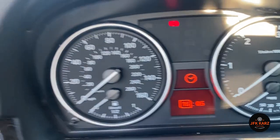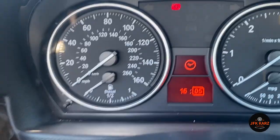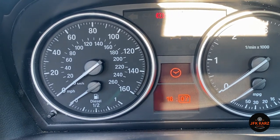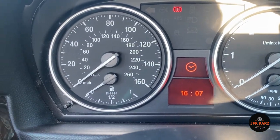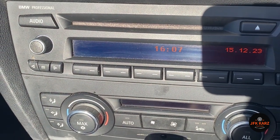Push up to get to 16, then push the BC button. Go up to increase to get the right minutes - mine is 1607. Push the BC button and that's the clock set done. Super easy, and it changes on your stereo too. My date is correct.